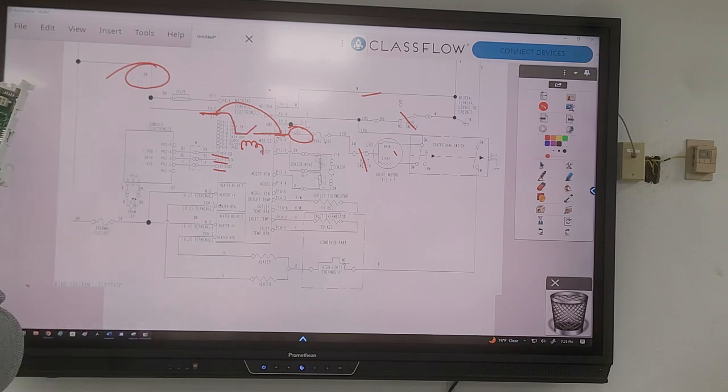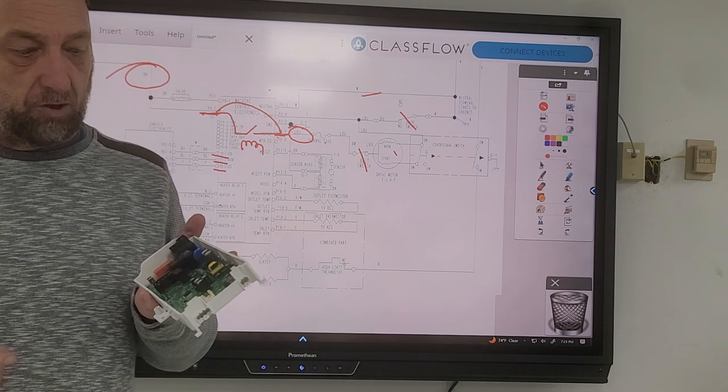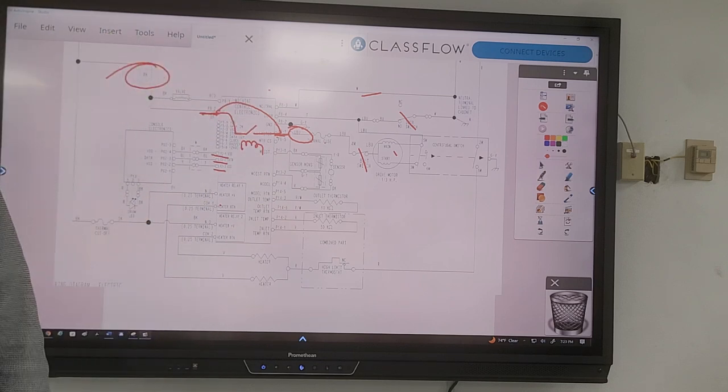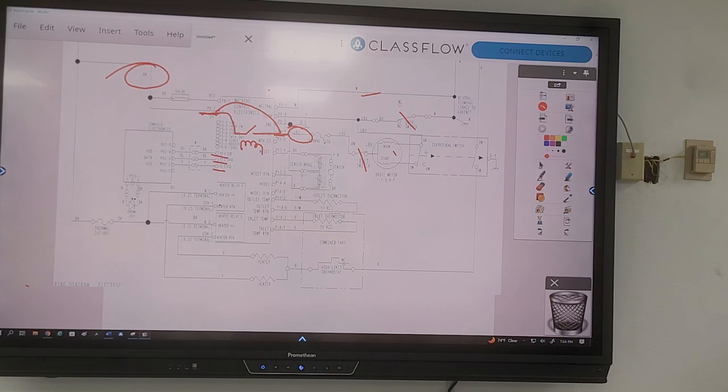The problem is there's no control - when the dryer's done with the cycle there's no way to stop the motor if you jump it out; the motor's always going to be running. If you open the door the motor will stop, but you can't control it on its own. That's what the board and the relay do - this processor here times out and says it's time to stop the dryer.